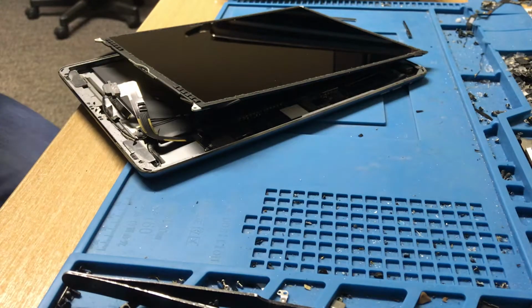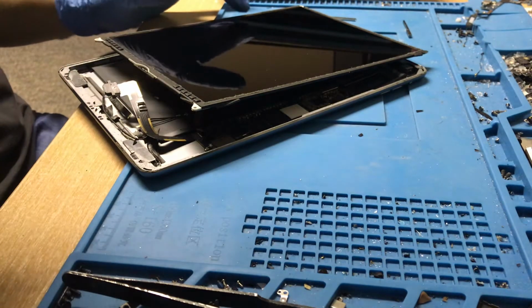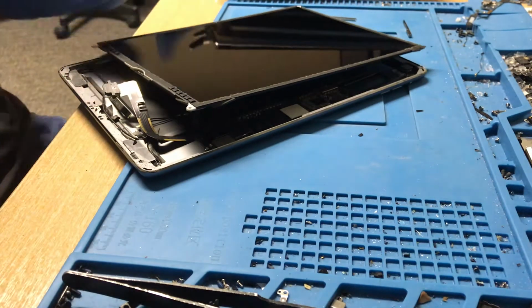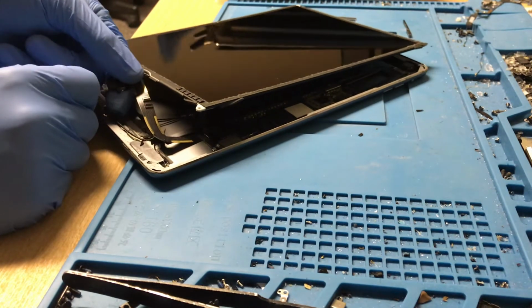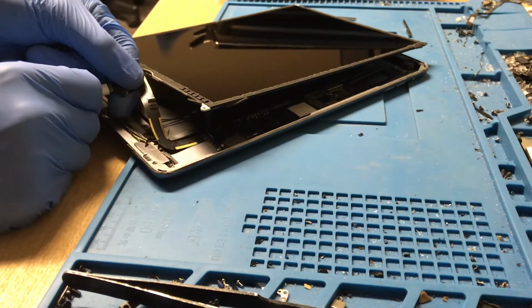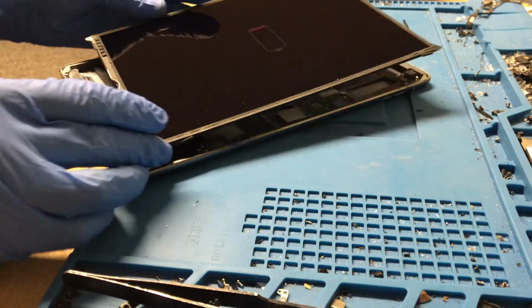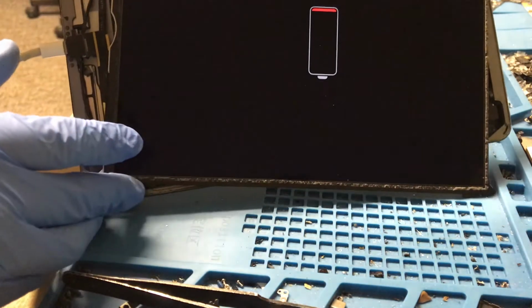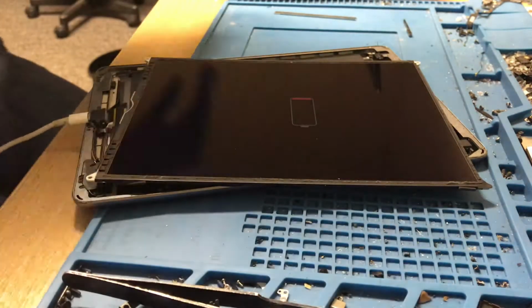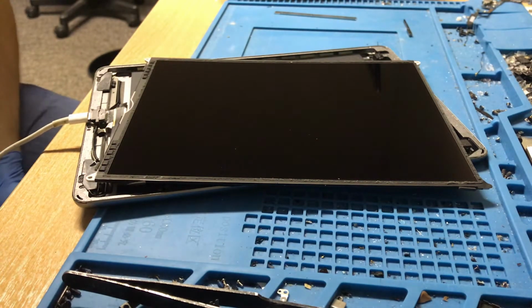Right, so now I'm back with this iPad Air 1, so yeah, a little bit of a drama. I repaired those tracks that were damaged, and there was actually 2, and that made no difference at all. So I went back to the drawing board, had a little look to see what was going on. We were getting all the voltage in. There you go, you can see the battery charging now. We were getting voltage in to the iPad, but we weren't getting anything through TriStar.